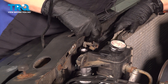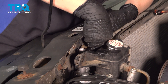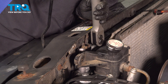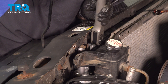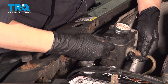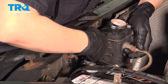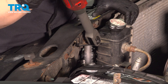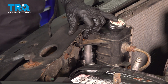After you have your lines attached and torqued, we are going to put this bracket in. Put your bolt in. Using an 8-millimeter socket, we're going to tighten up this bracket. Do the same on the other side. Now you can hook up your radiator using your bolt and snug it up. Once it's tight, go about a quarter of a turn. Do the same on the other side.